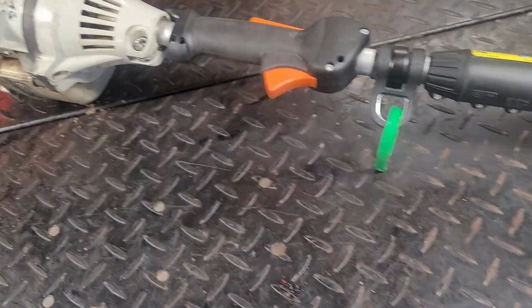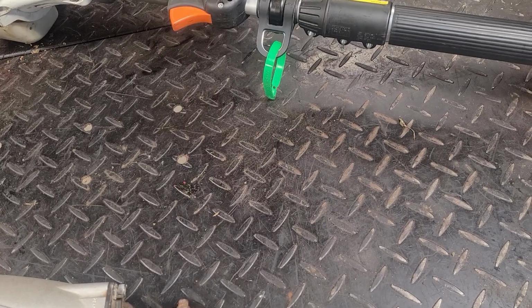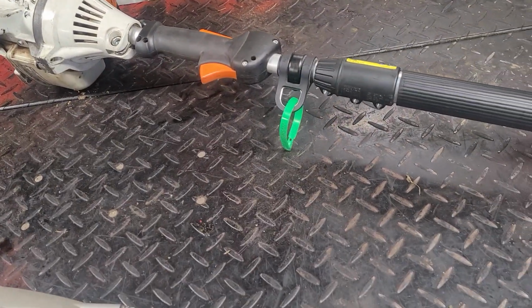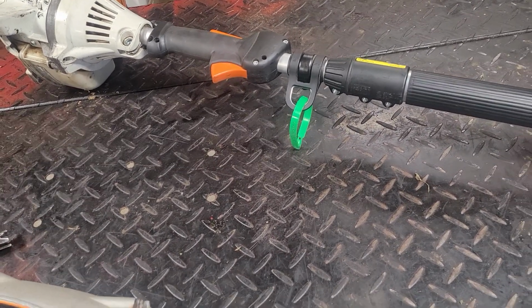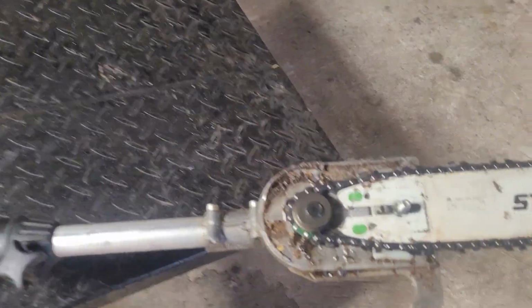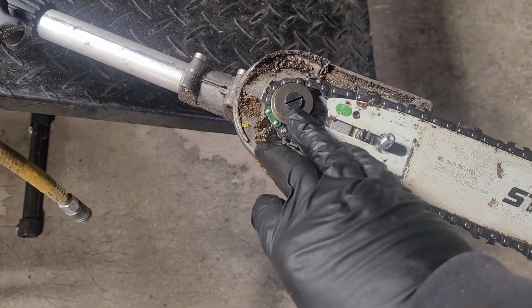In this part here, there's a shaft with a plastic bushing on it, a square shaft, which goes into my drum assembly. Those are notorious as well for wearing out, and you may have to replace that. But I went all through this. I looked at all my gears. I had the gearbox open, etc., and discovered this to be my problem.